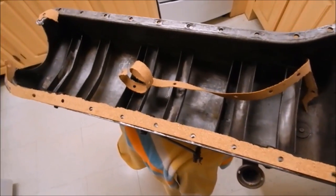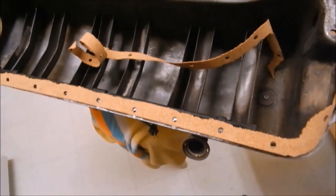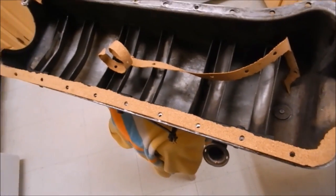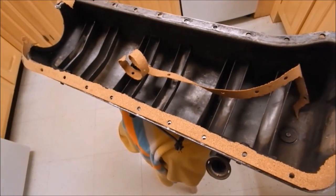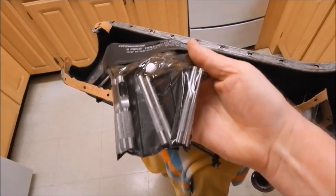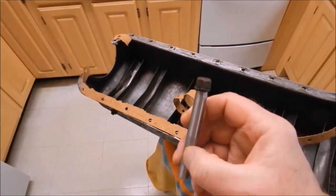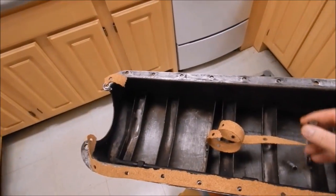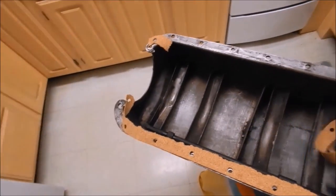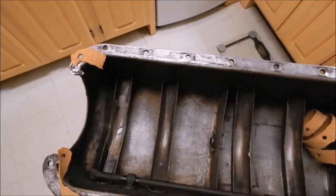I got the gasket all cut out and everything cleaned up. I'm going to put that gasket in — I don't care if it's broken on the end there. The way I make the holes in the gasket so round is with these things called a hollow punch set. It comes in all these different sizes — you can make all the gaskets you want with this. I use this size because that's the size of the bolt. And there you have it — next video the gasket's going to be on, even that broken piece.